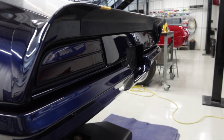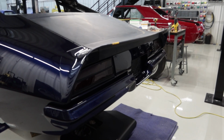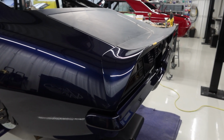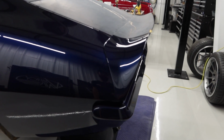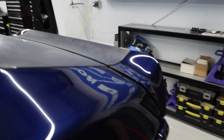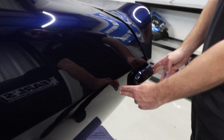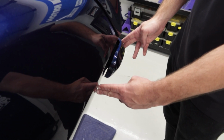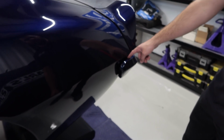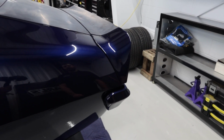It actually looks more like a traditional spoiler. You know, tail lights, tail panel in the car. I love how those sit in there. They blend into the car really well. Yep. And again, not having stainless chrome, polished trim or anything like that. That stuff kind of dies down. Also with the bumper on, you can see early 70s Firebirds, this bumper was actually probably 8 to 10 inches longer overall originally. So we shortened this thing back. And then there was actually a stamp feature on the quarter panel that also had to be shortened. So still stock styling, but cleaned up.